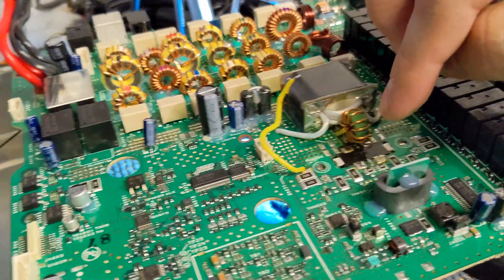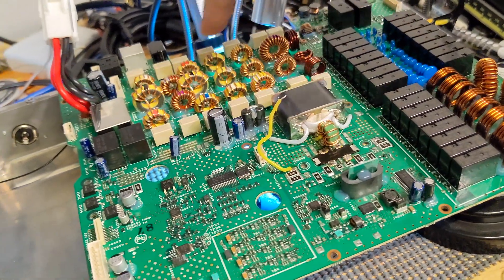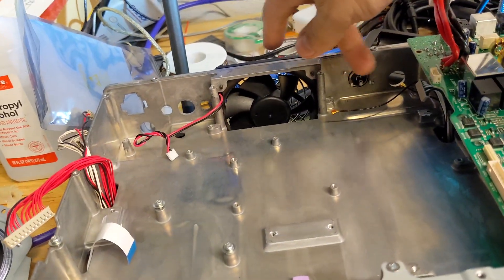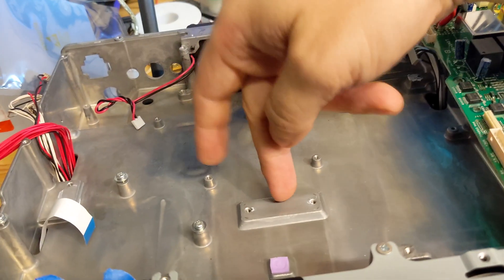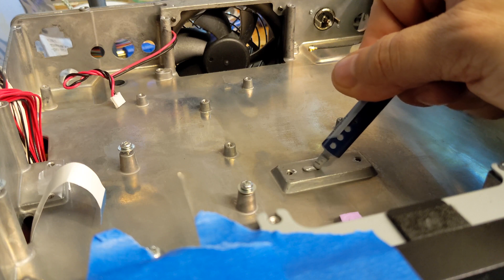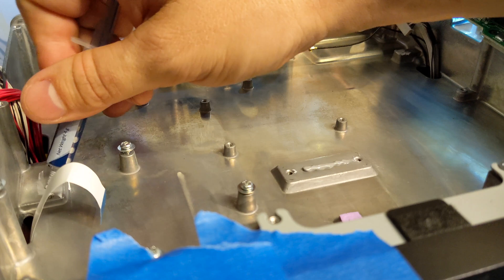So now it's in place, all tacked down, but about 20-some odd screws had to come out of here, all the different RF connections, all that stuff. The main antenna port had to be desoldered. It is a lot of work. Then we're going to put some Arctic Silver - basically your normal CPU thermal compound will be just fine. So that's here for the voltage regulator too. There it is.